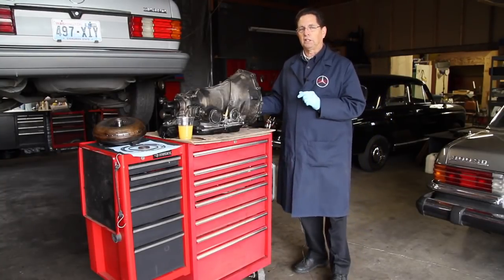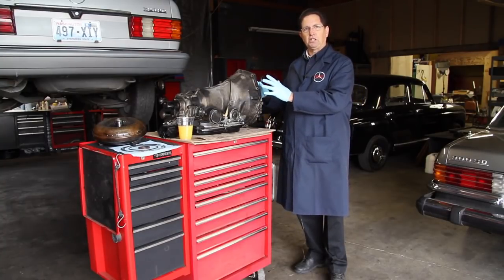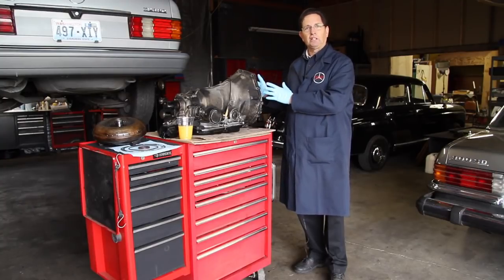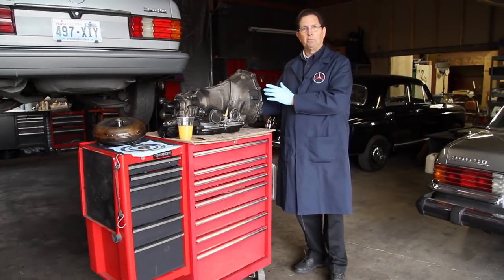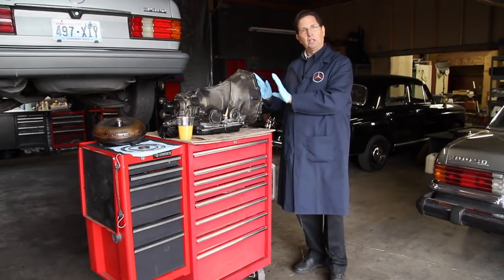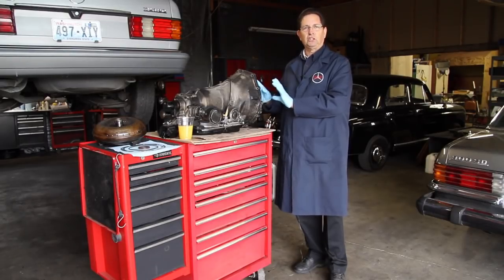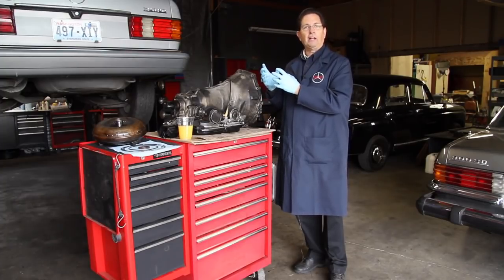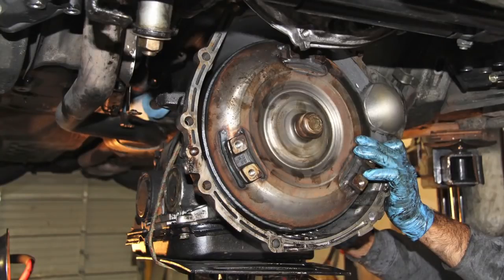One tip I want to share — I've received a couple emails from people who've had problems — do not try to remove the transmission and leave the torque converter on the flywheel. If you try to do that, you can damage the teeth inside the pump. The transmission and the torque converter should be removed together. If you loosen up the bolts on the torque converter flex plate and the torque converter will still not move, it means it's stuck to the end of the crankshaft. You'll have to get in there and pry it and work it loose, which allows you to drop the whole transmission down with the torque converter together.